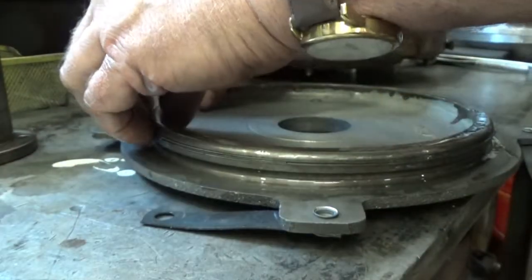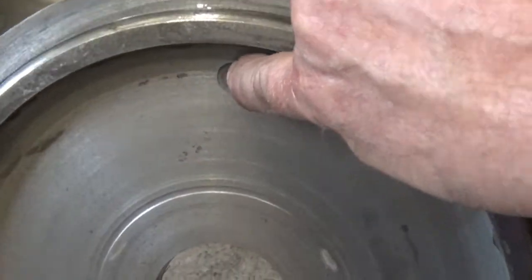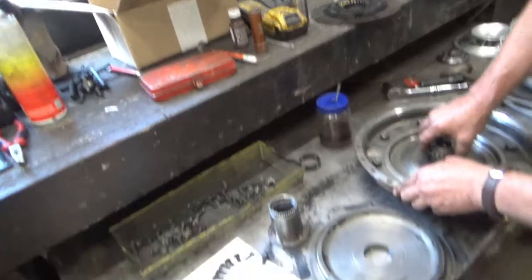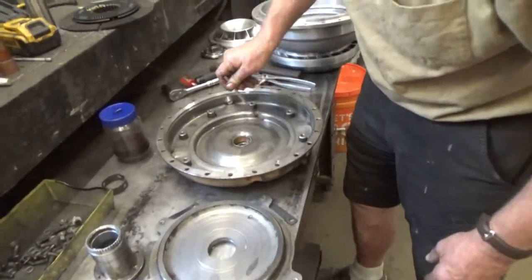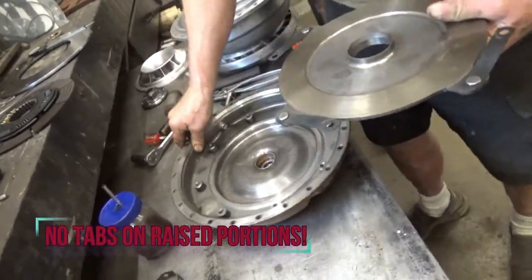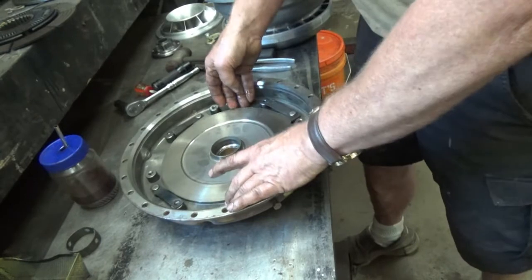And so they all move very nicely. I noticed that this mark here, this drill-bit point, means that this particular part by itself has been balanced, which means that you can put it back in any position because it's been balanced by itself. So let's put our piston in. Make sure that the tabs don't land on top of the raised portion, otherwise they will break off when the clutch releases. No tabs on the raised portion.